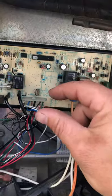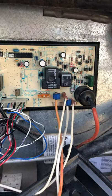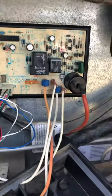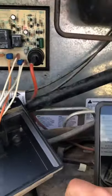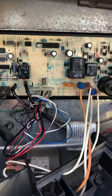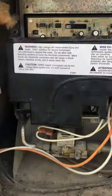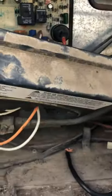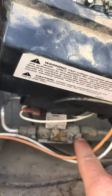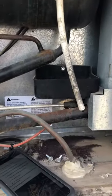The thermistor was super easy to change. Like I showed you, it was just a clip, and then there were two push-ins to connect to the light bulb. You just literally slide it into one of those fins and you're done. I turned off the fridge to do that, installed that, turned it back on. And as you saw earlier in the video, the green light is solid — I believe my fridge is fixed. This panel can go back on; there's just a couple of bolt holes. This is the gas valve if you're going to run gas — mine was off, but all good now. 20 bucks fixed.